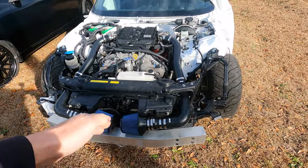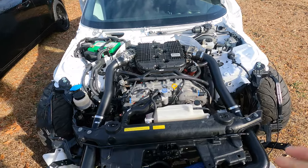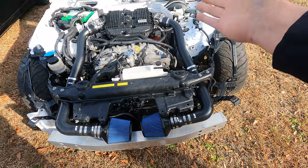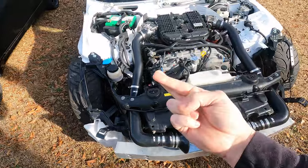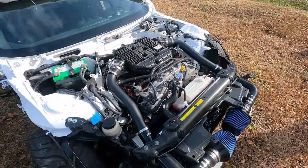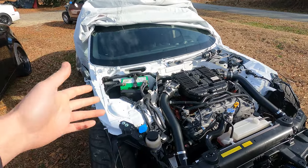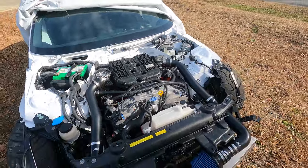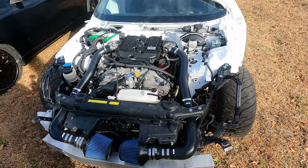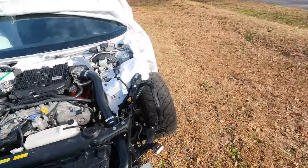I got the Z1 intakes on. Nothing weird happened hooking everything up and the front end is finally fully assembled, which will be heartbreaking if something is wrong and I have to take it all back apart. It seemed like it was running okay in the donor car but now it's running really badly. I drained all the fuel out multiple times and put pump E85 in it and it's still not happy. I ended up going with my old exhaust system and these intakes are different than what he was running, but I can't see that making such a big difference. I'm going to have to book a dyno day and let someone work their magic to get this thing tuned.